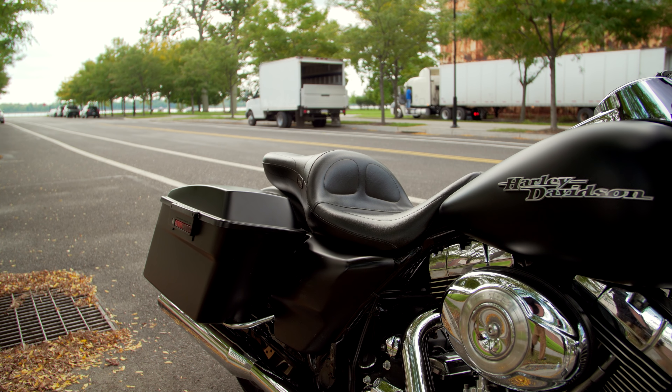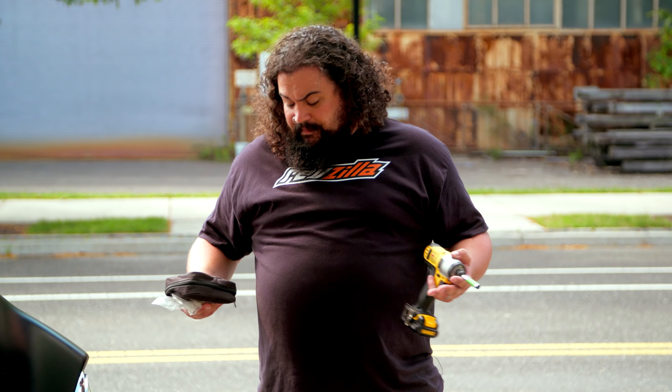Now there are some other things you need to know about the actual tire repair itself. Firstly, plugging a tire is not a permanent method of repair. This is simply a temporary solution to get you home, to keep you from loading your bike onto a truck. Also, not every single thing is necessarily repairable. Big cuts or slices, punctures bigger than a quarter of an inch — you can't fix this stuff on the side of the road.